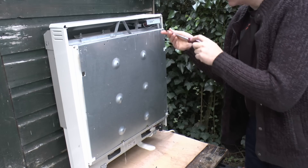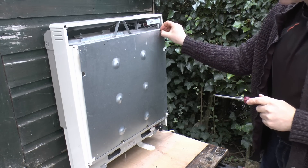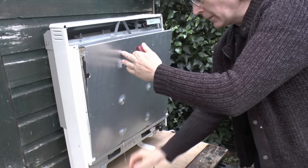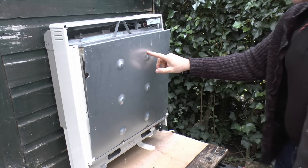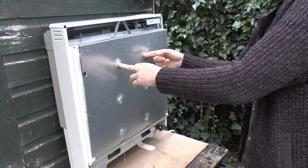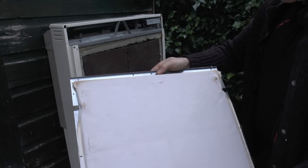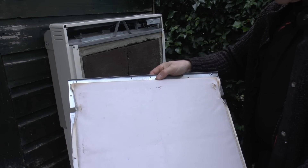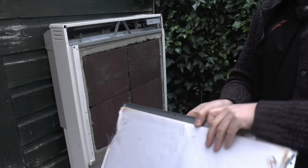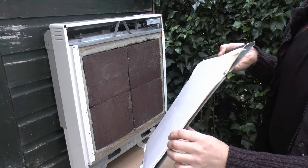If you're going to take old ones out, make sure they were switched off at least 24 hours before you come to dismantle them, because they can retain heat inside for a surprisingly long time. This is just a steel panel — these dimples just space it between this and the front cover to create an air gap — and this just lifts away. This is just an insulation panel here — not asbestos in this case, but on some older ones obviously it could be. Notice it's actually quite thin, so although there is insulation it's certainly nothing particularly substantial.